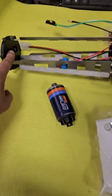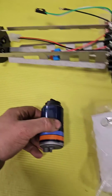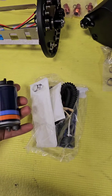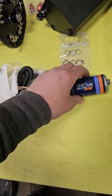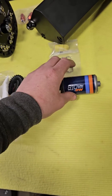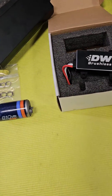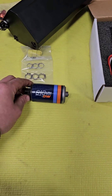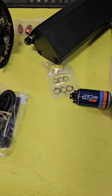The little quirk with this is you do have to drill this out a little bit here, but beyond that it all fits up normal like a regular Walbro 450. It's just much more reliable in regards to this single failure point, and you can make roughly 700 horsepower on a rotary with this pump.